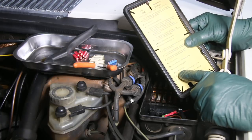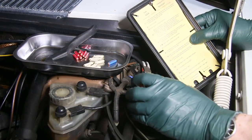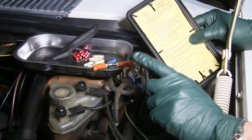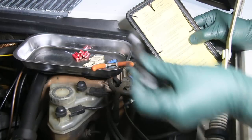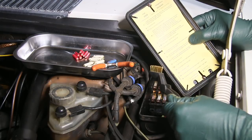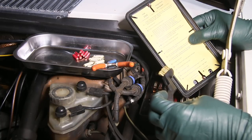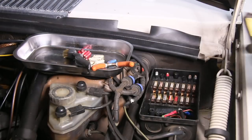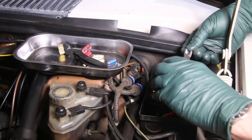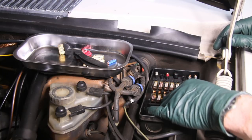I'm going to start pulling the fuses now — I've already got all my new fuses ready. Here's the tool I developed to remove and replace the fuses. If you've ever done this before, you know how frustrating it is, so having this tool makes the job go a lot easier. I've also got a brass brush to clean off any residue of corrosion left in the holders once the fuses are pulled. Let me show you how this little tool works — I'll start by removing number 14 to get a closer look. I just grab hold of it, pull back, and lift it out.